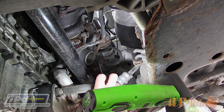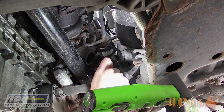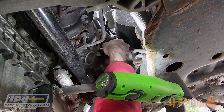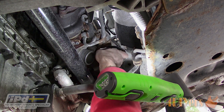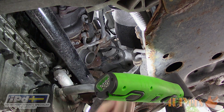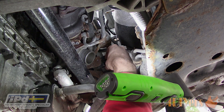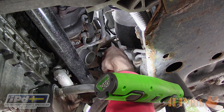It can be a bit tough to remove. I find using a standard screwdriver to help expand the plastic, then push it off. If the old valve gets damaged, it's not an issue as it's already faulty and will be getting replaced. Once removed, there will be an electrical connector on the TCV. Press the metal wire clip down and then pull the connector off.